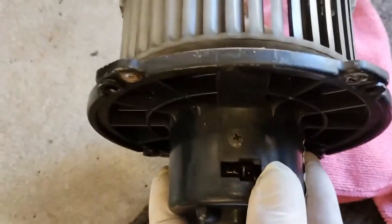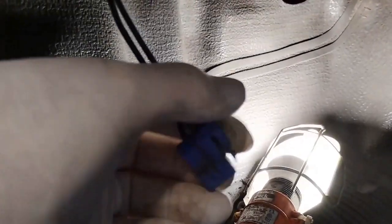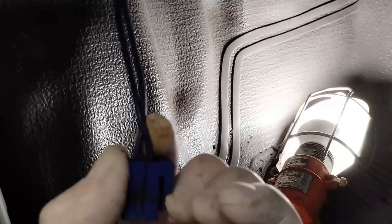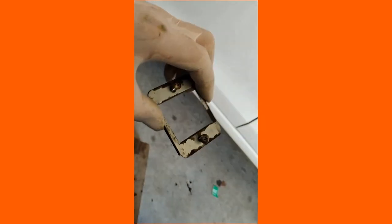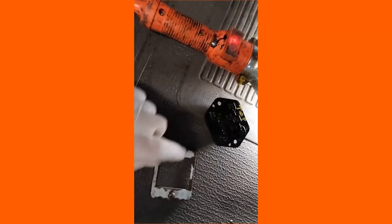There's one screw for the other side. The four screws are to hold the fan — one, two, three, four. That's the fan electrical connection. You can see the notched-out V on the other side of the fan connection. Push down underneath and that will release. The shroud will be on the inside and these two small screws — you'll have to hold that on the inside and pass it through this hole, then screw through these holes and into the thread underneath.